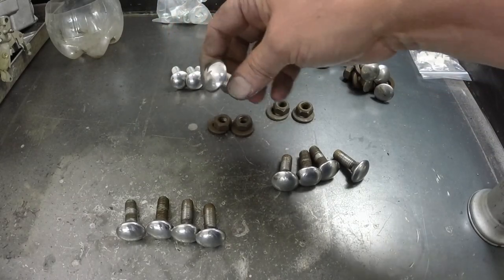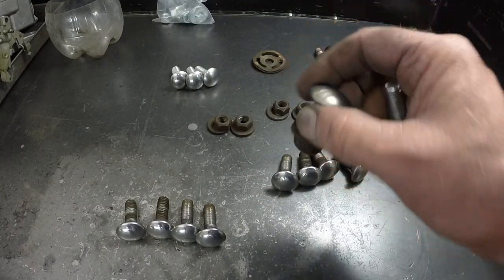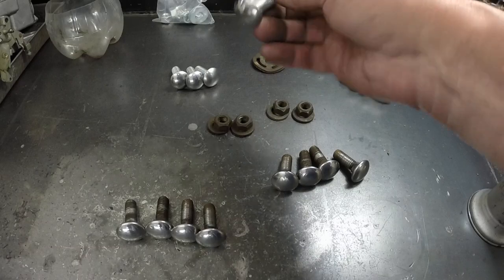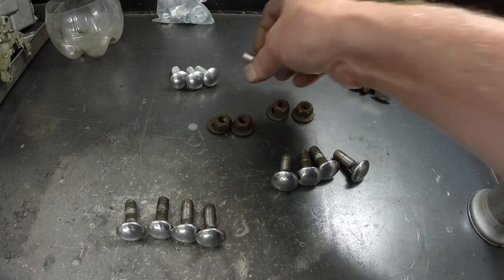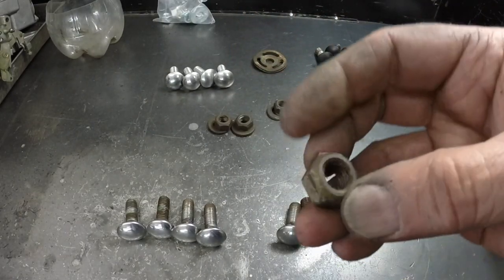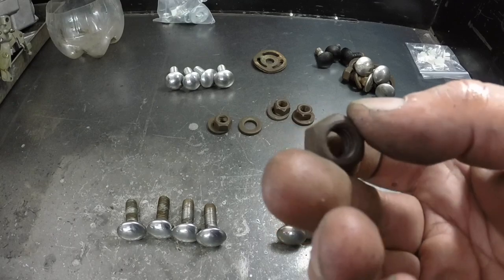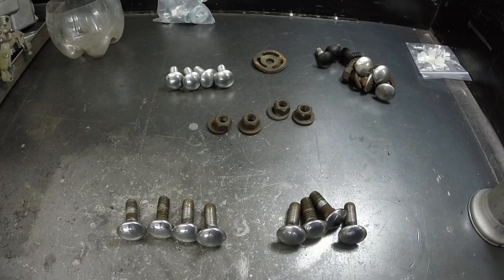I used them on the rear bumper because, you know, this was my option. And so I did have to use them on the rear. I'm not really ultra mad about them. I did buff the ones that go on the rear bumper before I put them on, much like I did these ones too. These are lock nuts, so I'm not going to run a tap through them, and they're in really good shape. You can see the threads in them are still kind of shiny metal color, so I'll just put some oil on them and reuse them.